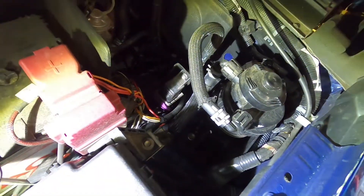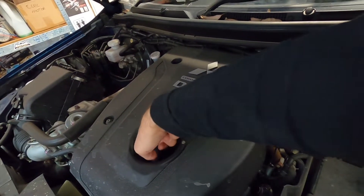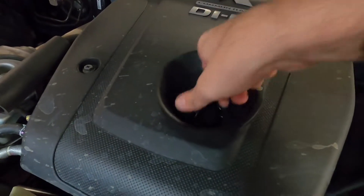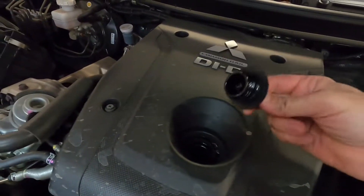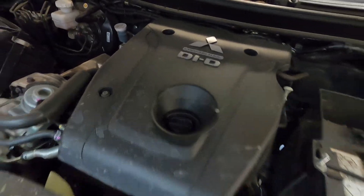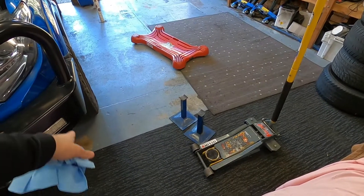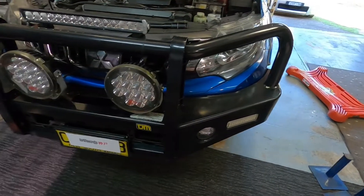At the back here is your fuel filter - we'll be changing that later. Once we've done that visual check, before we jack it up, I always pull the dipstick out just to remind me to check it afterwards. Take your oil cap off and just have a look inside to make sure there's no white milky substance in there, then sit it back. Now we'll get it jacked up - make sure you use stands. These are pretty good height, you don't really need to jack it up too much.